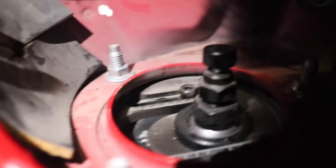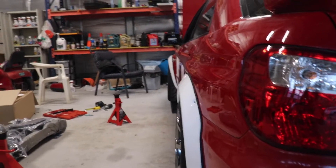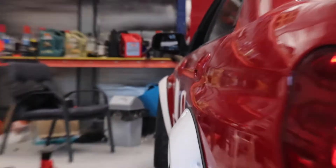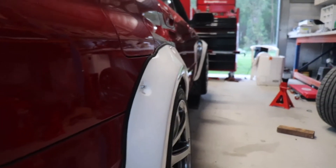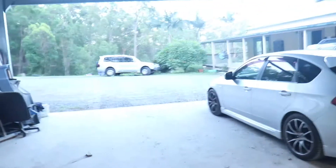I've got my torch with some extra lighting. I've actually moved the camber bolts themselves — you can see they're really close. If I go around to the other side to give you an idea, there's quite a fair amount of adjustment in where that middle thing sits. So I've actually moved the pins so it sits differently. Let's drop it and see what that side looks like versus this side. You can see this side is a lot better now — it's practically flush. Zoom in there to show the front: that is perfect fitment. I love that. If we go on the other side, this is what it looks like without that setup. Let's do it to this side and then roll it out for a quick wash.